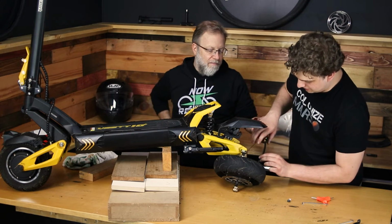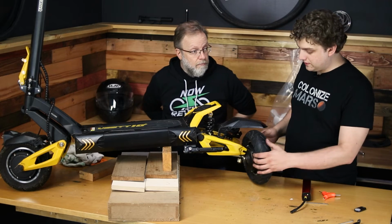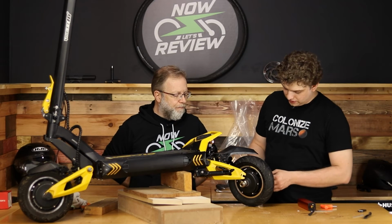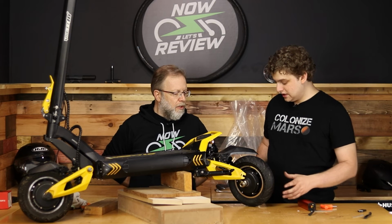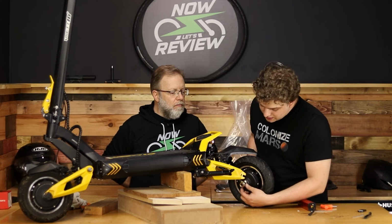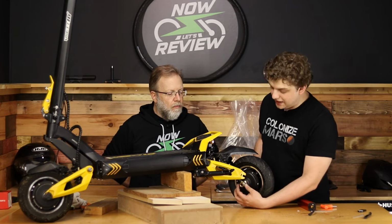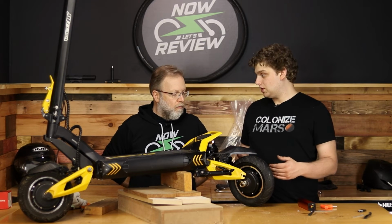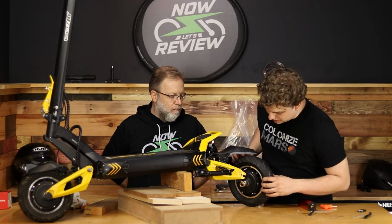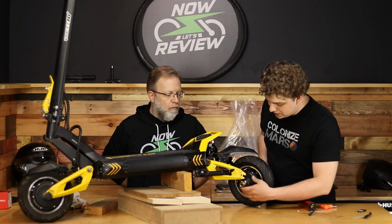You hold the pump itself. All right, so we've got our wheel ready to go back on. Nice that you kept your nuts on there. Yeah, so all the washers and everything are held in place. Make sure that there's an inner washer and 2 outer washers. And the other thing to keep in mind is that both the washers and the shaft itself are actually not round. They have 2 flats on them. So that's what we're going to put back on. We want to put it back on the exact same way that it was before, with the motor wire pointing down.